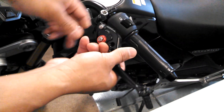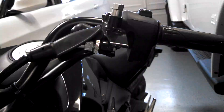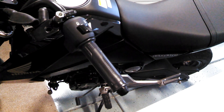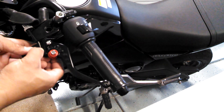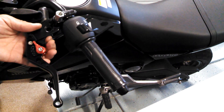Now I'm going to take my new lever, re-grab that ball, and install it in this hole. I was having a real hard time getting any play out of this steel right here to be able to attach my new lever. So I'm going to go on the right side of the bike and disengage where the clutch body attaches to the transmission. You simply pull it out like so. Now that I've disengaged the clutch cable, it should be plenty loose enough to pull out the little knob. I can stick that knob back in the new lever, flip it back upside down, and slide this in and line it up pretty easily.